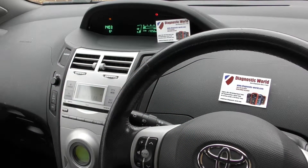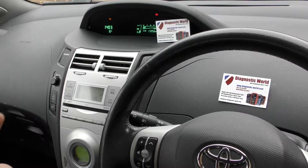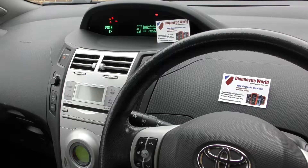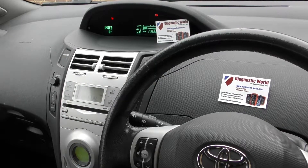The ABS light is still on. Now in the Yaris what you need to do is turn the engine off and then on again, and then you'll find the lights will all come back on and then everything will turn off again. So we'll stop the engine and start the engine. Lights are on and then gradually they'll all go off again. There we go.